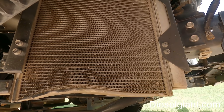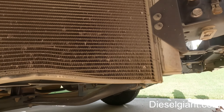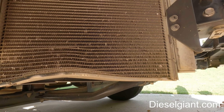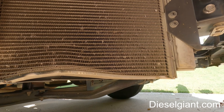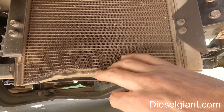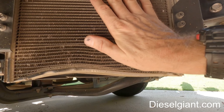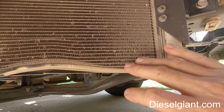All right, on today's video this is part two of the Isuzu NPR air conditioning rehab. Part one covered replacing the expansion valve — removing the air box, taking the expansion valve out, replacing the o-rings, and reinstalling it. This is the second part. The condenser is not leaking but it is damaged, crushed a little bit. I have a replacement condenser and this is not hard to do.